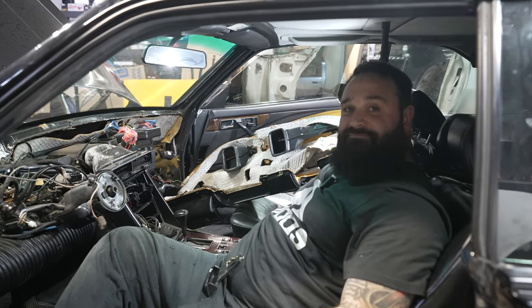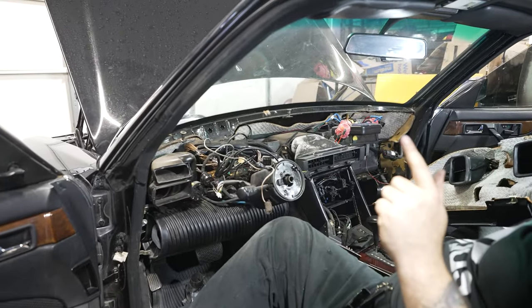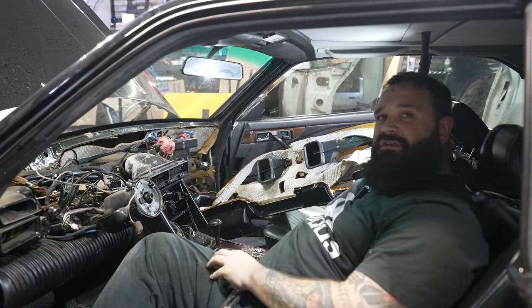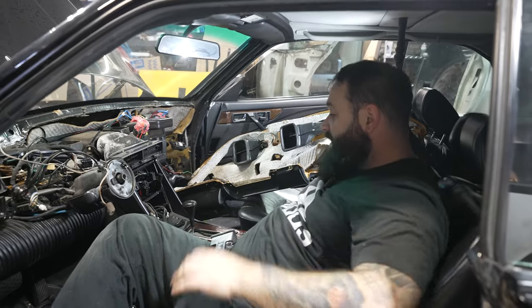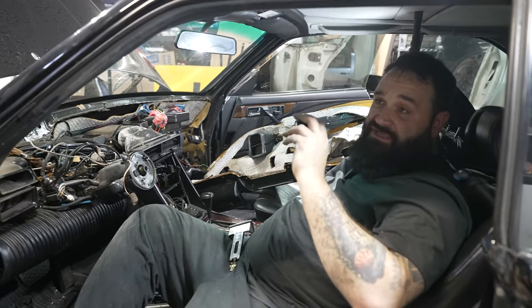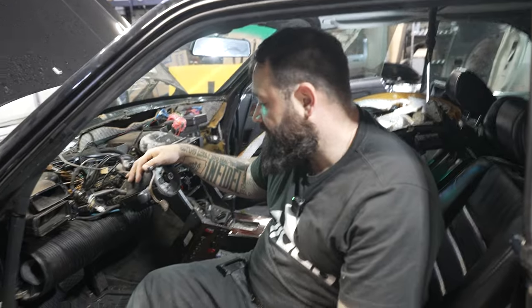Life is good — that's how you do it! Next video I'm going to be showing speaker installation — how to install front and rear speakers and amplify the system to bypass the factory amp. This is dash removal for the 560 SEC, W126 — pretty much all the same across second gen 86 to 91. The one mistake we made: we should have dropped the steering column down — it's just two bolts — would have saved us a headache at the end.